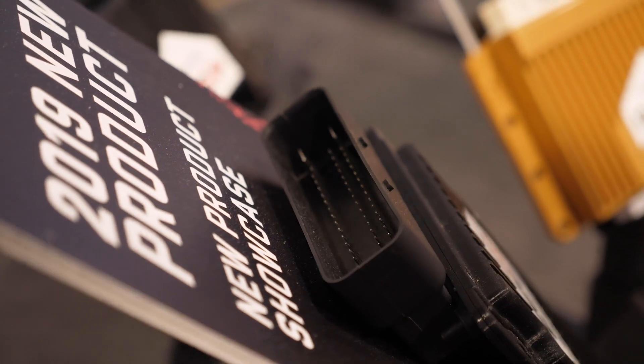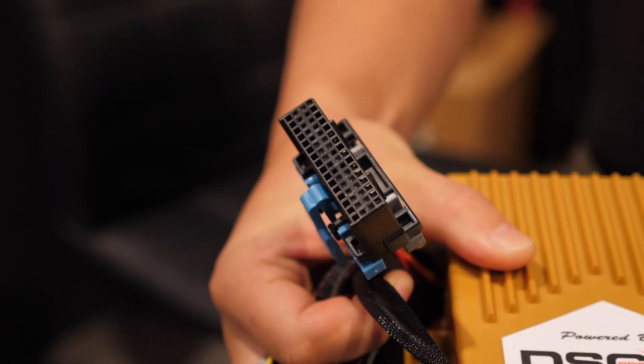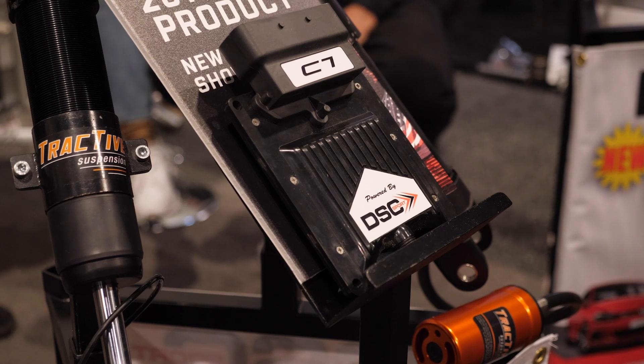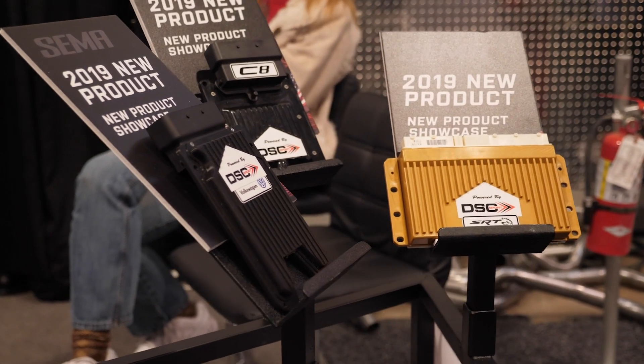The other sensors used are velocity sensors. If you're braking on a bumpy patch, the sensors will pick that up and we subtract a certain amount of damping force to make the car more compliant so it remains stable in the braking zone. Essentially: you're coming into a braking zone, suspension is relatively compliant so it doesn't skip over bumps. When you hit the brakes, you stiffen the front suspension for weight transfer to optimise braking force — but if you're on a bumpy section, you soften it slightly to remain compliant.